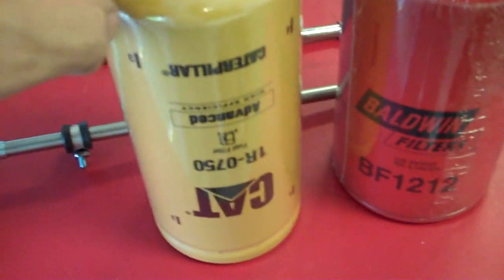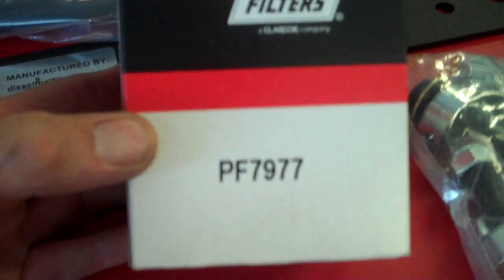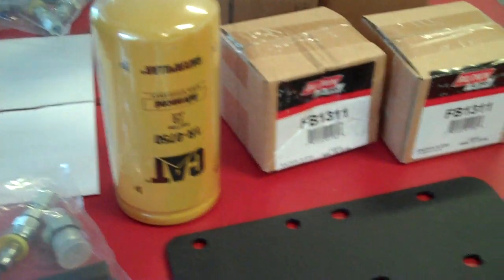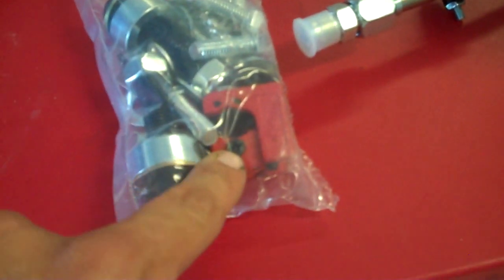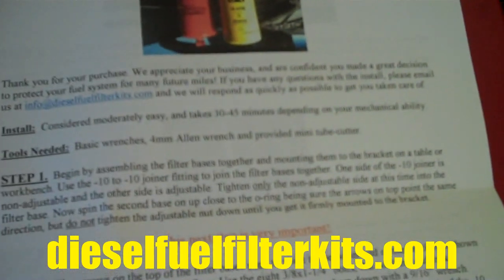This is going on the Dodge. It's going to get me down to two-micron fuel filtration as opposed to the factory seven to ten micron, which is not good. I offset that by putting the Baldwin five-micron PF797 in the factory fuel housing, which I'll continue to use as a secondary water separator and secondary fuel filter. This will prolong my injectors, give me cleaner fuel, keep water out. They say it's a 40-minute install — cutting the fuel line is the only part that might be a little scary. They did send color instructions.